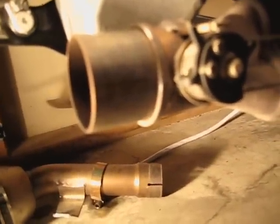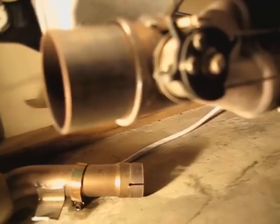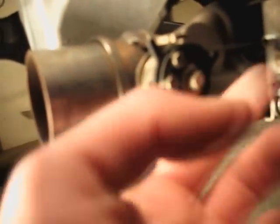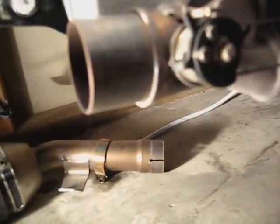So we're going to take that out, disconnect these wires. You want to turn the key on and then wait till that valve is open, so then you can disconnect the wires from this guy. So once I get that removed, I will play some more video for you.